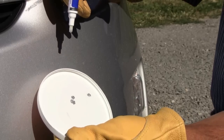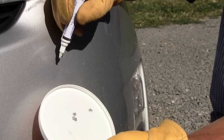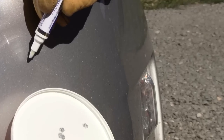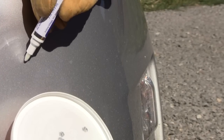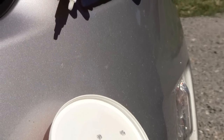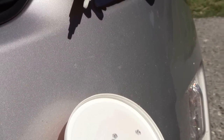Do not press this on your car — you'll run clear coat right down it. All you want to do is get that tip so it's fairly dry, and just spot right over that chip. A little chip like this, it almost just totally disappears on your car. Job's done.